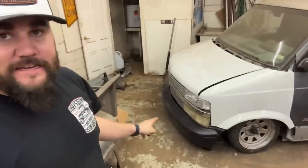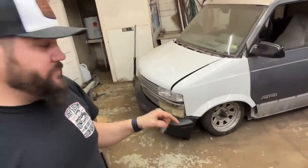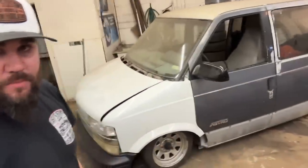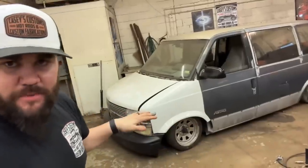Now the bumper is gonna need some modifications because right now this whole front end of this car is held up by the bottom lip. So I'm gonna shave that down a little bit. That'll help it get down. But we actually did take a little too much metal out of it, and it's lower than it needs to be now. So what I'm gonna do is probably put another bag mount in so it'll get the suspension up a little bit. And we're gonna end up running much more normal tire because that's a real little bitty guy. I don't think I'm gonna go as big as what I have, obviously, but kind of somewhere in the middle of those two. It'll get the rear end down a little bit more, and it'll give me more room with the front end. Because right now with it aired all the way up, I only have like 2 inches of ground clearance from the frame, which is not good. Whenever you hit a pothole, you don't want the thing that hits to be your frame. You'd rather it be something else. So we'll end up raising it a little bit, but it'll still be on the ground, if that makes any sense at all.